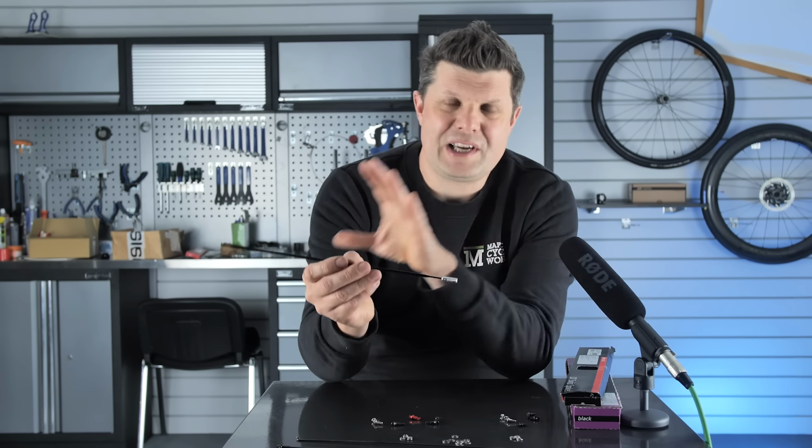As a general rule, when you're considering buying a set of wheels and they don't mention the nipples at all, I would normally consider them to be a 12 millimeter aluminium, because they've got nothing interesting to shout about. If they're advertising brass nipples, I'd say that is a good thing in terms of durability, but quite a lot of wheel brands try not to, so they can get that headline lightweight, because let's face it, most people buy wheels on how much are they, how heavy are they, and try and find the best compromise.